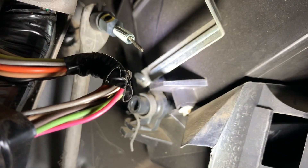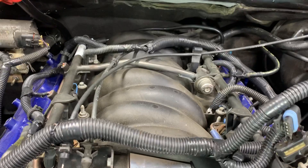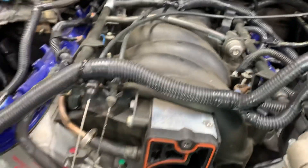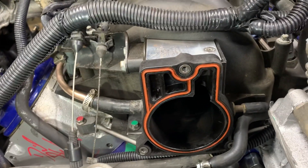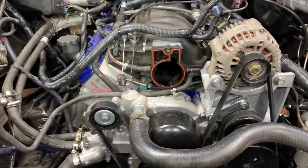What I did was I went to AutoZone, and they had what's called a carburetor kit — actually a carburetor choke kit. Or you can get a carburetor throttle kit. It'll come with that little clamp I just showed you. What you're going to want to do is pull your throttle cable through the firewall, hook it up to your gas pedal, pull it snug, and then put that clamp on there. Test it — have somebody look at your throttle body while you're giving it gas, make sure it opens all the way up. If it needs adjusted, it comes with a little Allen key. You can loosen it, slide it out a little bit or put it back in a little bit, and try it again.